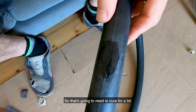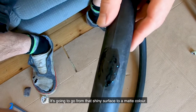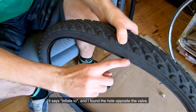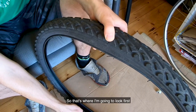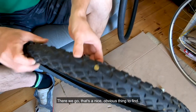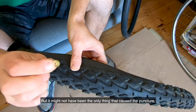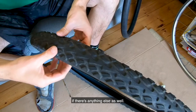That's going to need to cure for a bit — it'll go from that shiny surface to a matte color. The valve of my inner tube was underneath where it says 'inflate to', and I found the hole opposite the valve, so that's where I'm going to look first for anything that might have caused the puncture. And there we go — that's a nice obvious thing to find: there's a drawing pin. Pull that out, but it might not have been the only thing that caused the puncture, so while you're there have a look to see if there's anything else as well.